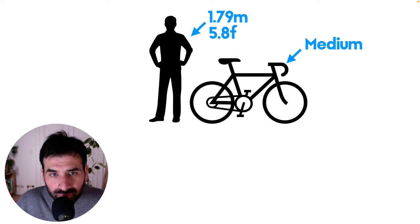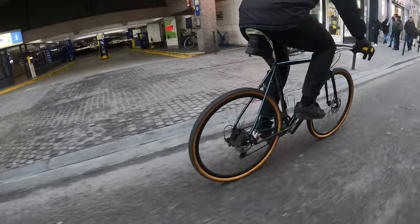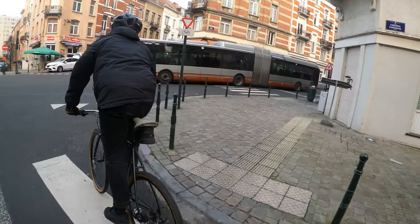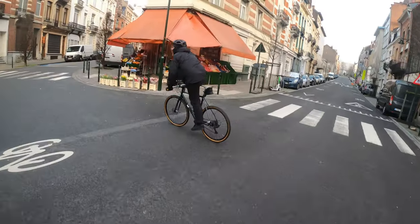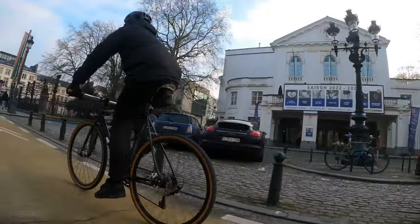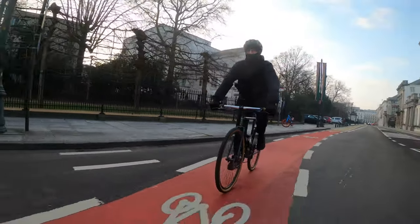This frame is medium and Albin is 1.79m. The size medium is slightly small for a 1.79m person, but there are some advantages to that — a smaller frame is lighter and more reactive than bigger frames. If this bike is going to be mainly used for commuting, having a very compact frame size is nice. If the bike was going to be used for long rides or bike trips, I would have gone for a large frame with a smaller stem and a less aggressive position for more comfort. The fact that the frame is a tiny bit small for Albin and that the head tube angle is quite steep left him with a small toe overlap of about 2cm, but he got used to it. Going for a 650B build can help with this issue, as the wheels would have a smaller diameter. The link is in the description below.